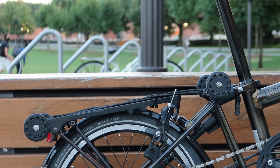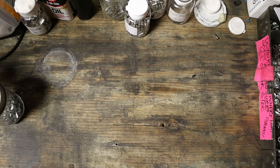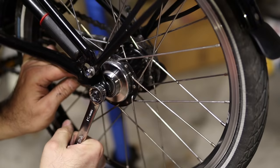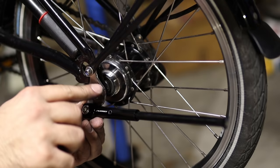Now that I'm considering using the rear rack for cargo or having a bag mounted on it, I need a way to keep the bike standing up without having to flip the rear wheel under. For that I'll be using a dedicated kickstand — this one is from Silver Rock. It attaches to the wheel axle and rack bolt on the left side of the bike. Installing it requires removing the axle nut and the rack bolt, putting the kickstand in, and stacking everything back in the right order.